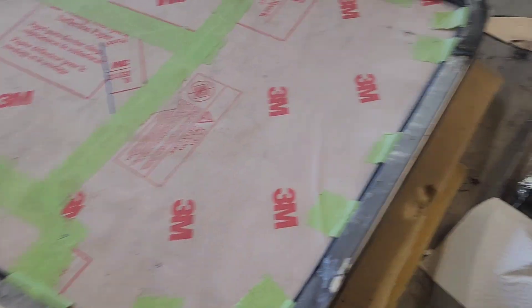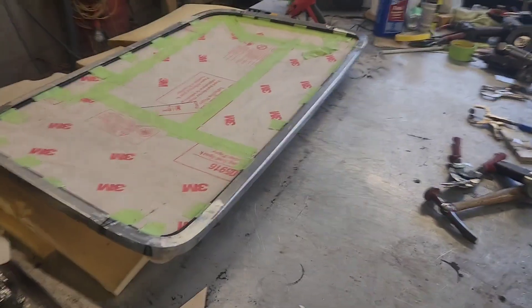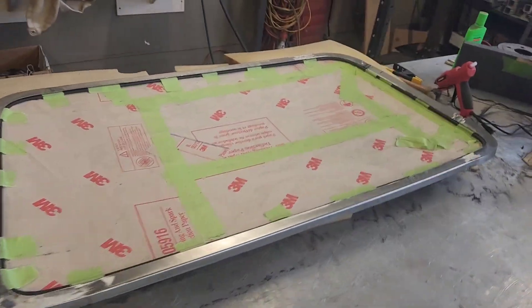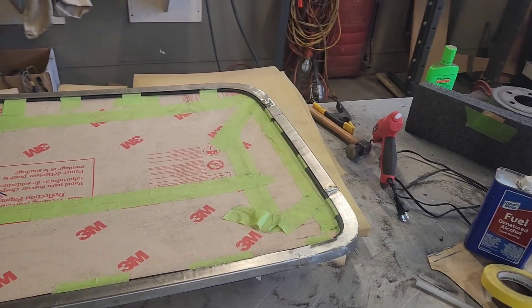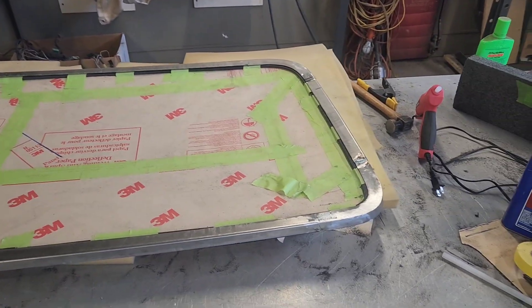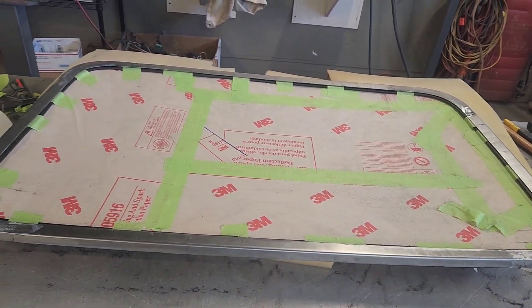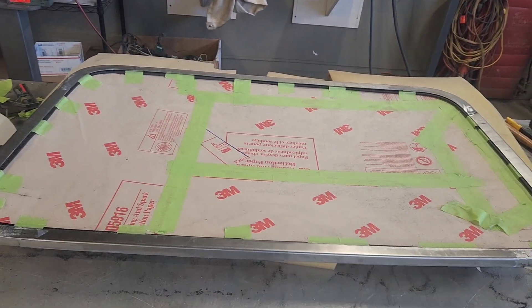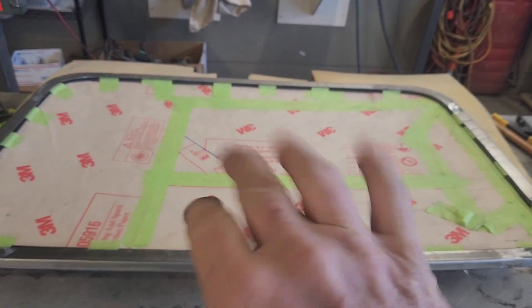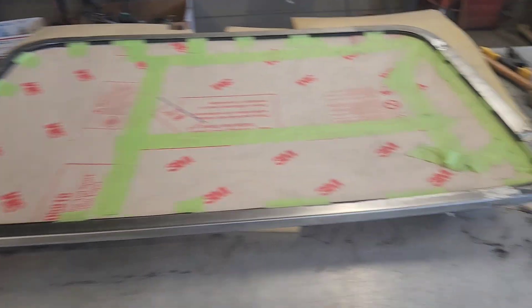This is what the window bed looks like - it's upside down on the glass. That's everything stitched together, welded up, ground off, cleaned up. Now I've got to start fitting it to the car. One challenge is I've got to make sure it stays in a flat plane, so I need to figure out how to cross-brace it so it doesn't twist when putting it in the car and create low spots. Right now I could lift one corner and the rest of it stays on.